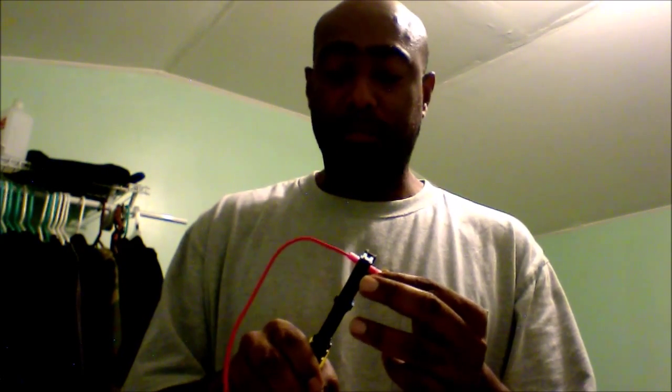The other methods for repairing wires are soldering. There's a solder splice where you would just put these in. I don't think you can crimp it and heat it down so it seals it. Now these splices, they do not seal, so you would have to put shrink wrap or heat shrink on it, and you put those on the end before you put the splice together, because if you don't put it on first, you're never gonna get it on. Plus, you don't want to be trying to slice a piece of heat shrink down the middle and just slap it on. That doesn't work either.